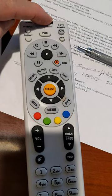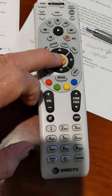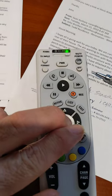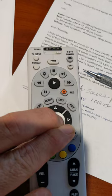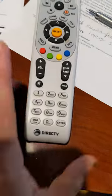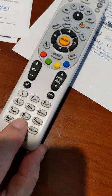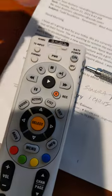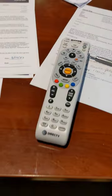First, push this slider over to TV, and then hit select and mute until that light flashes twice, right like that. The number for a Sony is one zero zero zero zero, and this light up here will flash twice when it takes it. That's for a Sony television.